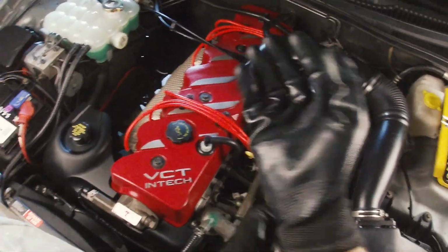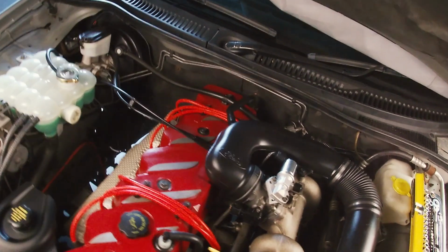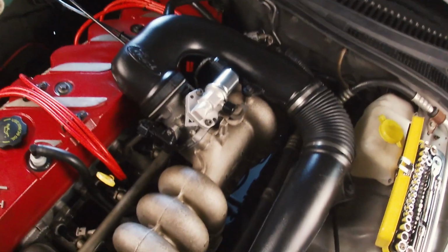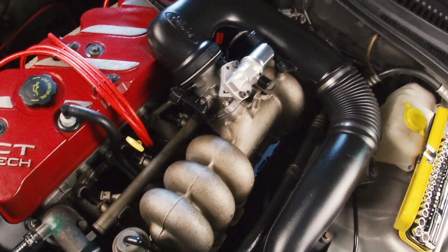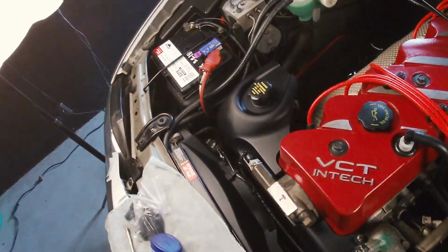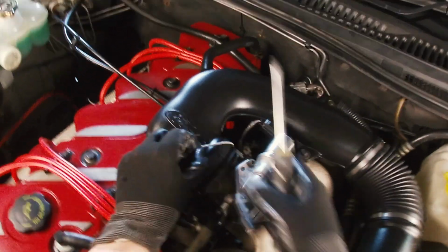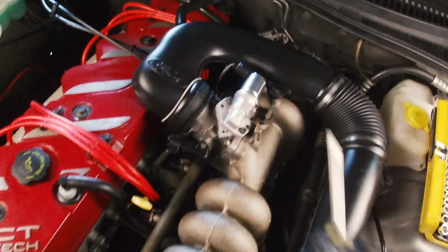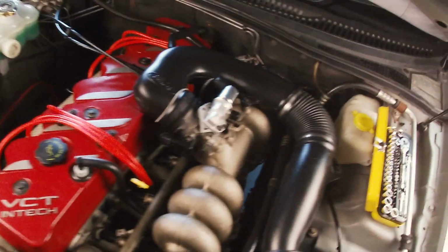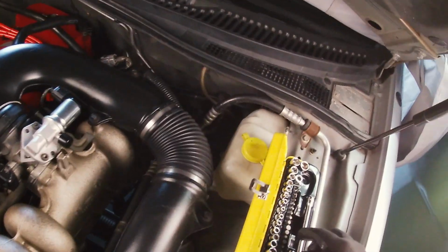On today's episode, I'm going to be throwing some new fuel injectors into my AU Fairmont Ghia. And why am I doing that? Well, this car has a bit of a cold start issue. You go to start it, the first lot of cranking, and you can just crank it forever, it doesn't start. Second time you crank it, it will start, but it doesn't start very cleanly.